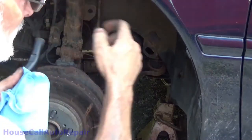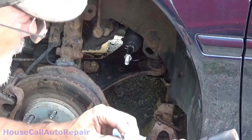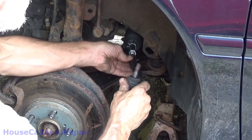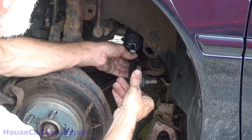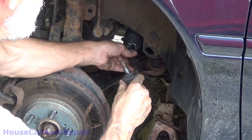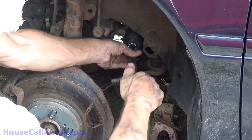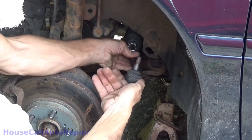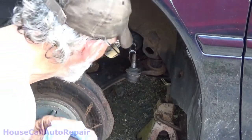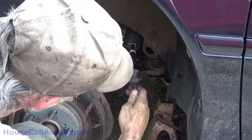Over on this side, let's see, pull the blue thing off. We're more than 15 turns in on that nut, so let's go ahead and take our driver's side tie rod end and thread this on. 15 turns. It starts to catch right there. And we said it was a little more than 15 turns. So let's make sure we're started here. Okay. Now we'll count into 15 turns. One, two, three, 13, 14, 15. Now this is not absolutely critical, and these were actually facing downward, but we're gonna pull it back half a turn,